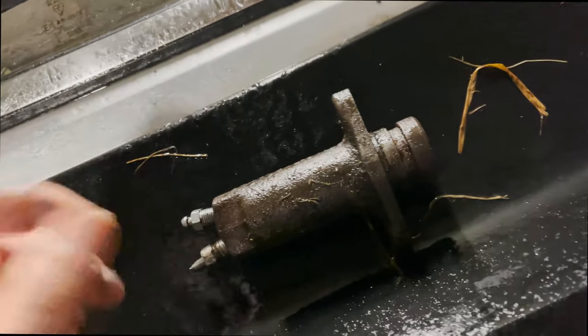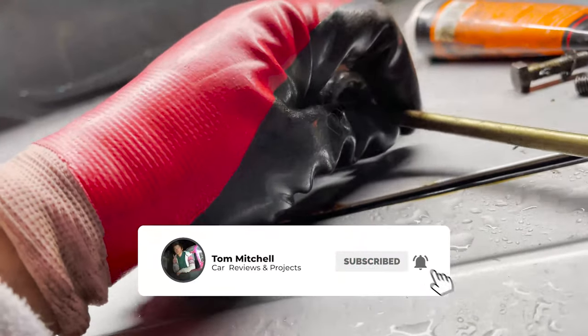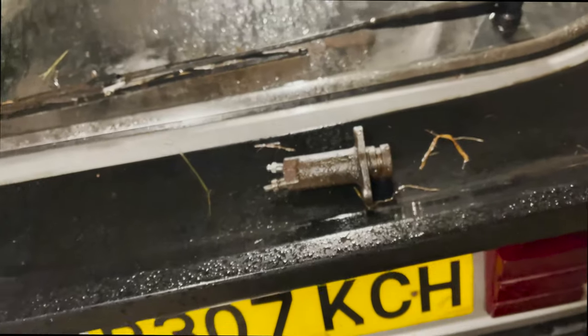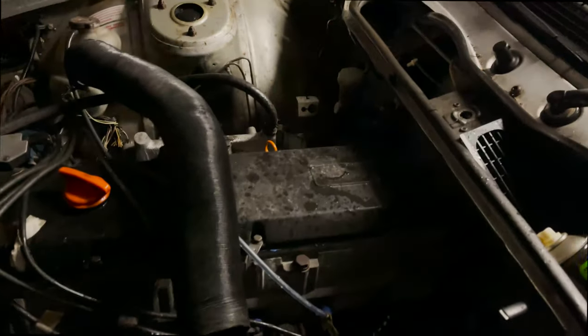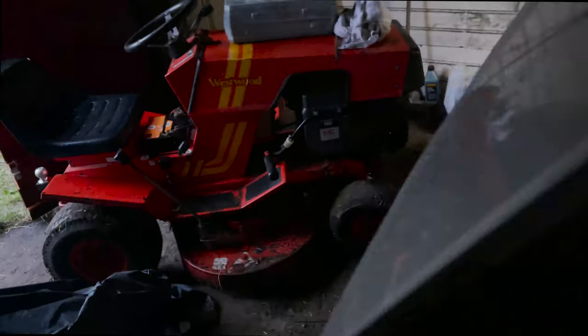And push it back in with it closed. On this one though, you cannot push it in at all, as you'll probably see by a demonstration on there. But so far we've got the welding done, we've sorted out, we had a new master cylinder on there, but it's absolutely pants. It's made out of like some chewable aluminium, so it's literally gone to pot the minute we put that in. To be fair though, I think we did cross thread it.